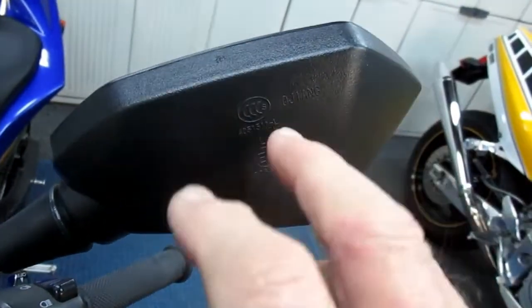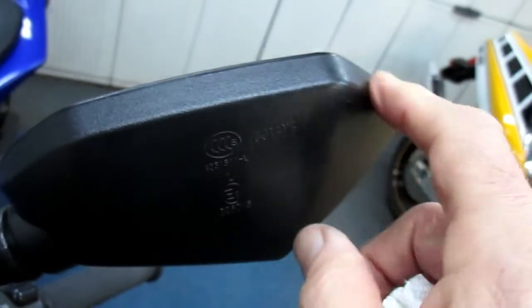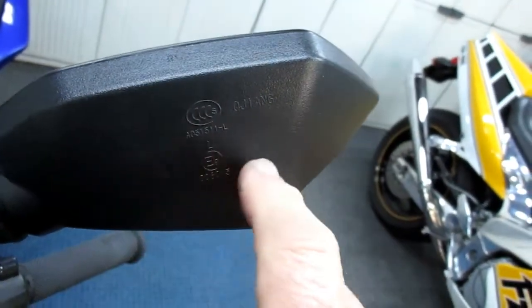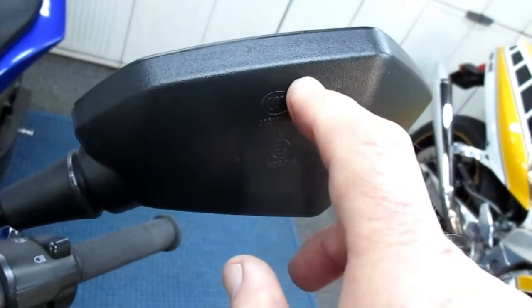So always remember, to get a finish that you can paint, I like to just sand it, and try not to gouge it and scratch it any more than you have to. In other words, you don't want to use 80 grit sandpaper and a power sander. That's not a good thing.